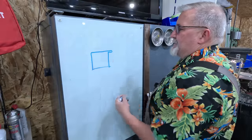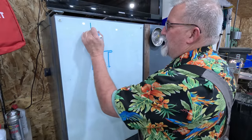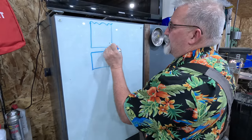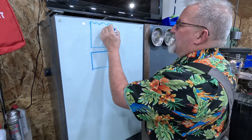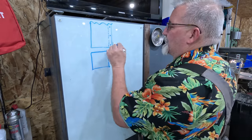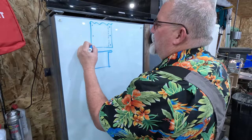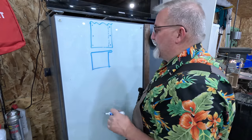This is the top of your seat, right? Let's look at it from a top view here. So here's the long seat of the Jon Boat, and say we're gonna place a seat here. What I'm gonna do is take this lip here. This lip underneath is something about like that, right? Well, I'm gonna drill like 3 holes, I believe, over the course of the 14 inches. And we're gonna put one of those nut serts in there. If you don't know what that is, stay tuned, you'll see what it is. They're a miracle tool in my book. And we'll put like 3 more right here, so we can put some threaded holes that'll hold up to something in that aluminum seat.